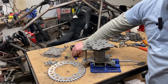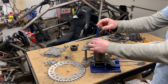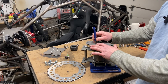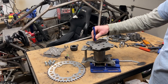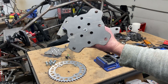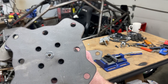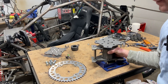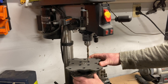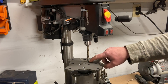That's nice and tight. I'm going to get my centering punch, which is three-eighths, and put it right in there — that's perfect center as long as this is straight up and down. Be very careful when you do this; there's not a whole lot of room for error. Tap it, and now we've got perfectly centered punches ready for drilling. I'll use my depth meter and drill to about one and a quarter minus the distance from there.